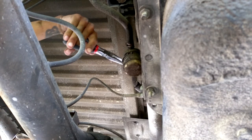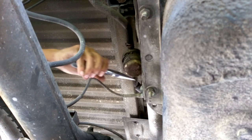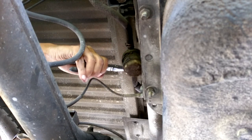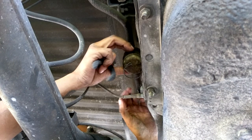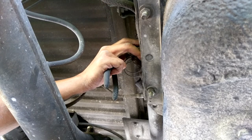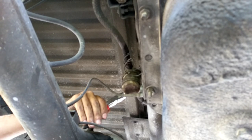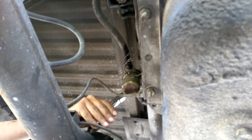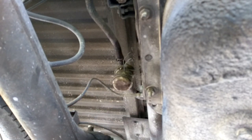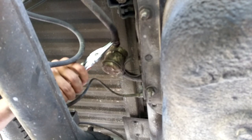I've got to at least unplug that side of it. Get some pliers, push the thing open and move it out of the way — and hope it doesn't break. Normally you do this: you squeeze open the little clamp and slide it back, and everything should move. However, this is a 1990 vehicle, so nothing's ever that simple.